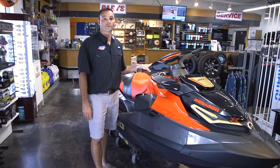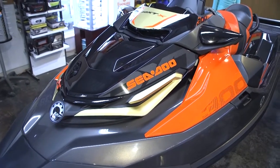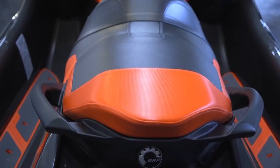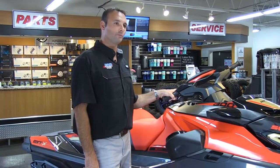One unique feature of the Sea-Doo watercraft is that the computer controls the break-in period. It will slow the throttle response, speed, and RPM for the first five hours, then unrestrict up until eight hours. You will not have full power of the ski until the break-in period ends at approximately eight hours. We recommend you fluctuate your throttle during the first 10 hours to break in your motor properly.